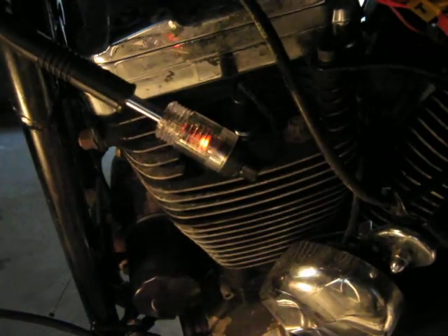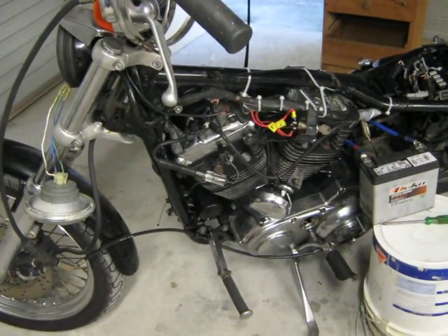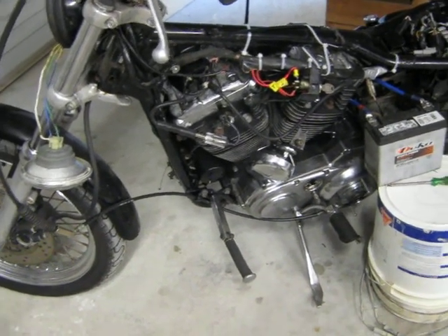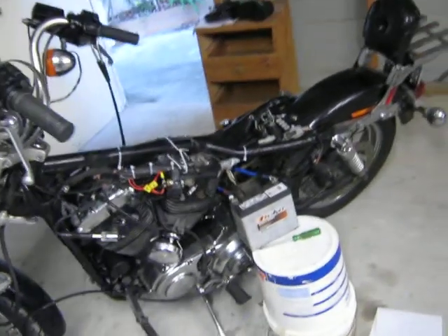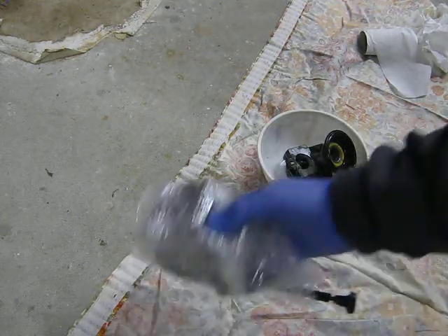Okay, we're going for a spark plug test on the front cylinder. I've got these new spark plugs. That's a good spark on the front cylinder now that I've swapped the spark plugs around. I'll swap them around again and see what I get. Okay, spark plugs swapped around. So a summary of the spark plug test is that there's good spark on both the front and rear cylinders. So that turns it into a fuel problem.